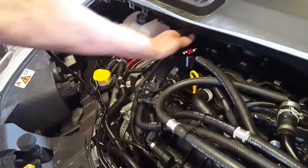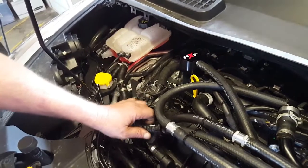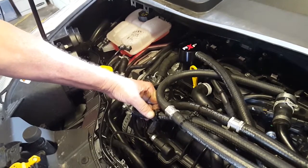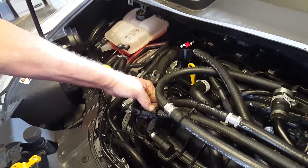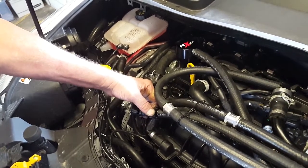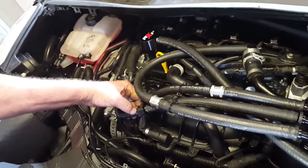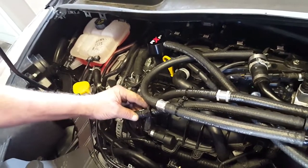This is the foul or dirty side coming from the backside of the valve cover. We have a black plastic half-inch barb that's been machined down that fits snugly inside of this, and you put a couple drops of superglue on it to keep it from coming out.